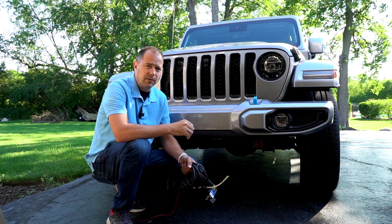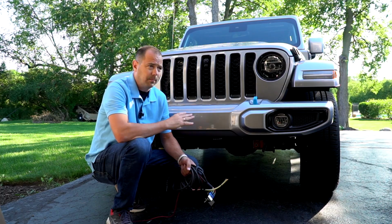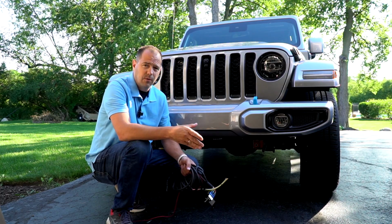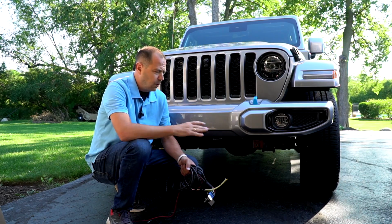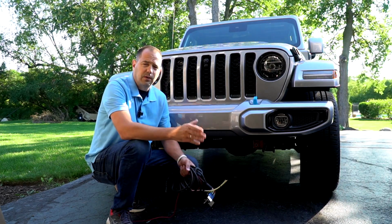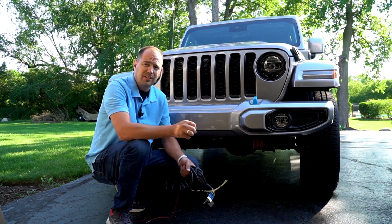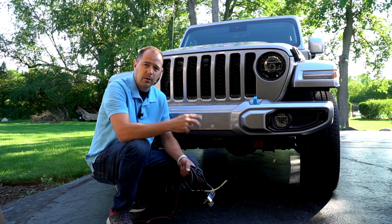You'll see people on the internet talking about using the regenerative braking to charge the battery while it's being towed behind the RV. Horrible, false information, would cause a ton of damage. Your transfer case always needs to be in neutral, and your transmission always needs to be in park while you're towing. Few things that happen.